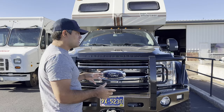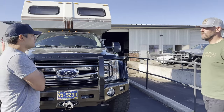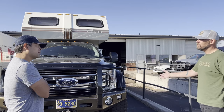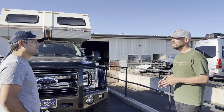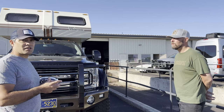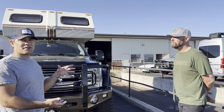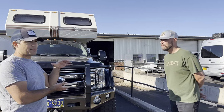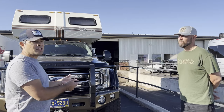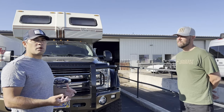Is there anything else we should know about the super single and this conversion? It comes down to the ride quality — it's really good. The big portion of this comes from the tire as well. Having a rigid wheel that's not flexing is going to help a lot with tracking stability and handling on the road. Then having that additional sidewall from the larger tires dampens a lot of the micro-vibration. That in itself, before you even get to the suspension or the frame and chassis, is eating up a lot of road noise and vibration.